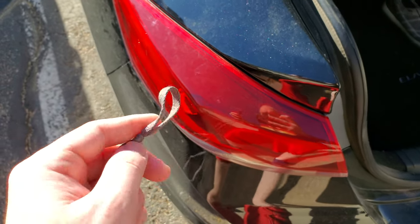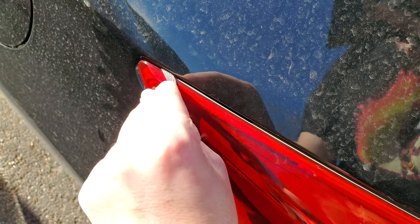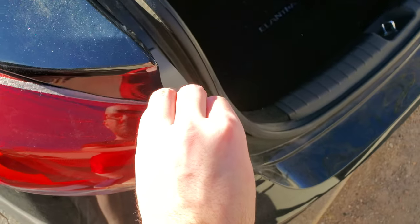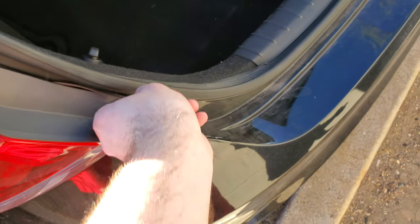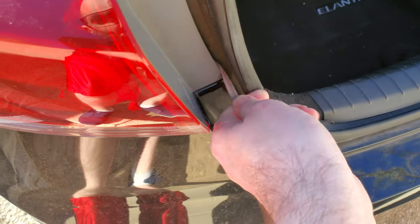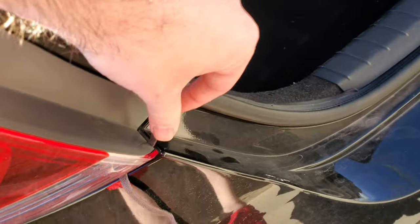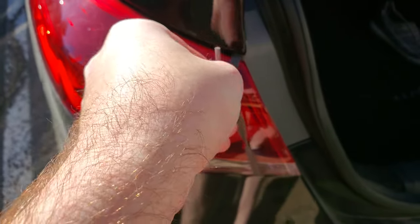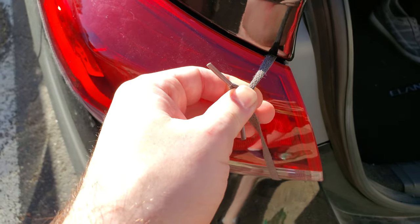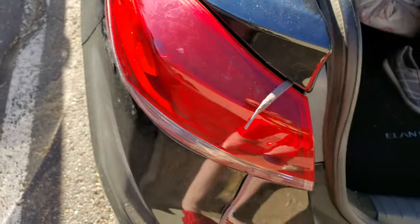So I have the shoelace — the loop — we just slip that on the end there. Once you have the bolts off, there's enough wiggle room. You can pull it taut, take one string, route it up and around. I'm gonna bring that all the way down — I don't have the bolts off right now, I already finished replacing it. You can bring it down, take the other string, do the opposite. Once you get them routed, there's enough slack — tie them together. Right hand here, left hand here, pull towards the back, and the whole unit will come out.